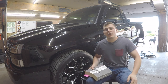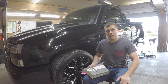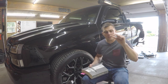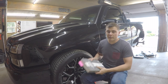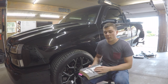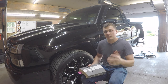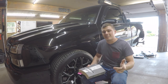Welcome back — this is the part where we reflect on life choices because I just made a poor one. I snapped a bolt. Here's what happened: if you do your own maintenance, get a proper service manual. This is book one of five just for this truck. I looked up the bearing cap torque — it said 136 foot-pounds. I thought that was way too much, looked it up online, also 136. Still didn't believe it, so I triple-checked myself and went for it. Got to about 115 foot-pounds and snapped it.